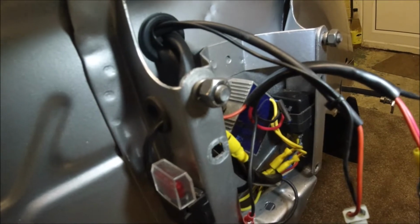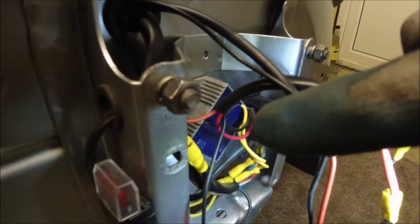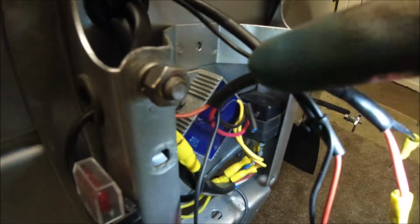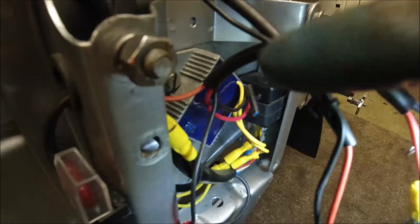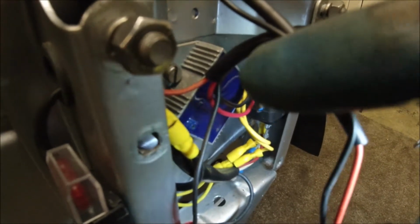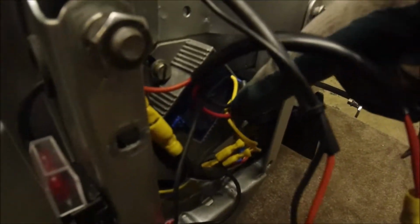So you've got a 12 volt plus, so it comes up on the cycle, and then when you would have got a down cycle, which normal regulators don't use, they blank off, so all you're getting is the high point of the cycle. When they say cycles, anything electric is a 360-degree circle. So you've got a phase which is a plus phase, which is 180, so it's half a circle, and on a DC system then it would block off the downward phase in effect. But what this regulator does is it flips and flips back again, so that you get in effect a peak and a peak. So both of these yellows are always plus 12 volts.